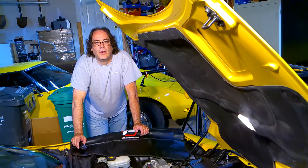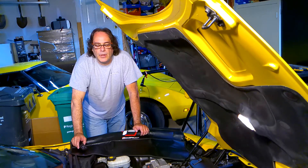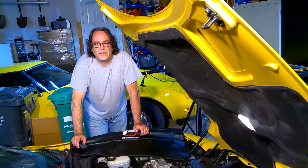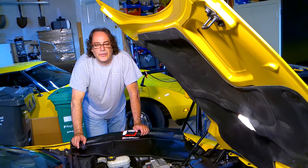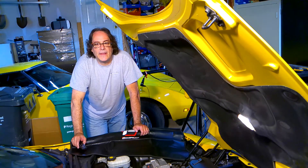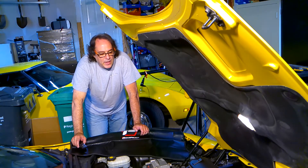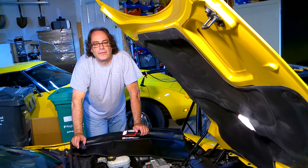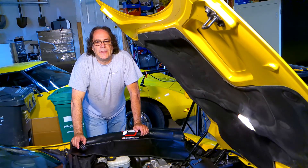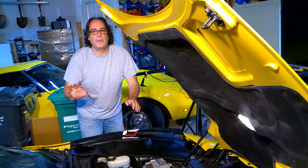Alright, there's another job done. Two new belts on the 02 Z06. Both fairly easy — you do not have to remove any components to get those belts in place. The lower belt for the air conditioning unit is a little more difficult to get lined up, just because it's tight quarters and it's hard to see down there. But once you get it lined up, it goes on quite easy. The serpentine belt, same thing — once you get it lined up, it goes on quite easy. I'm quite happy it got rid of my squeak — that squeak's been driving me crazy. So I'm going to button it all up, put the hood down, it's a nice day outside, I'm going to take her for a boot. I hope this video helps. Please subscribe — it really helps the channel out. So until next time, Mr. G says keep the rubber side down everybody. Take care.